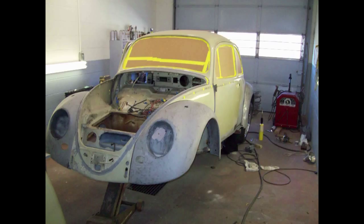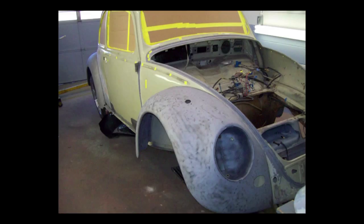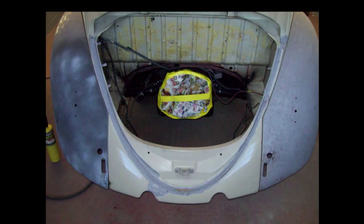At this point in the restoration I decided to go all the way down to the bare metal — sandblasted all the way down. Sandblasting with my small sandblaster takes a lot of time, but that's one thing I have plenty of. Mask and tape any areas that you don't want sand in. You don't want sand in a transaxle.